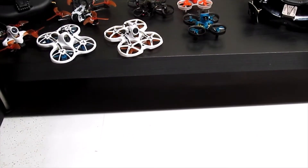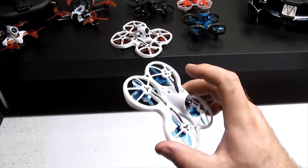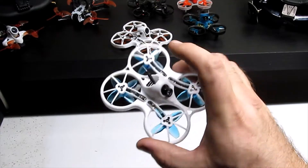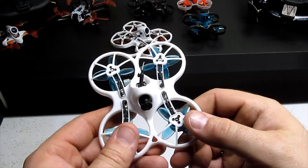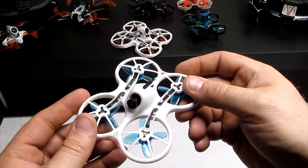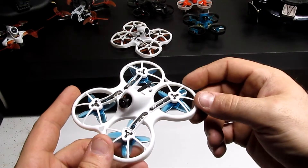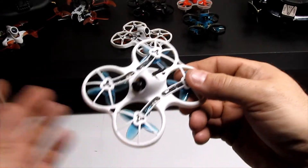What's going on everybody — just wanted to do a quick video on my Tiny Hawk, basically cleaning out the motors. This applies to pretty much any brushless motor. The issue I was having on my original Tiny Hawk was that after a slight bump crash, the left rear motor wasn't working — it was moving freely but not spinning up. You'd fire it up, all the props would spin except that one, and it would just stutter around or spin in other directions.